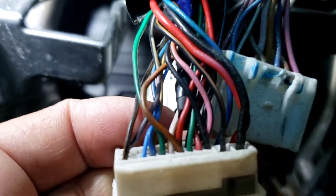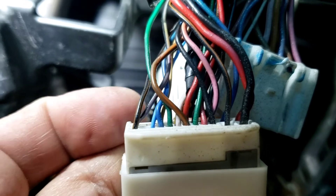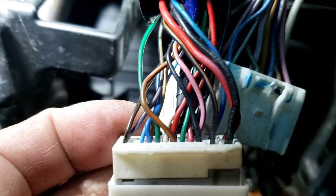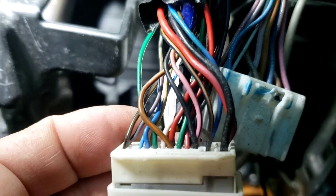I'm not sure exactly which pin number it is — I didn't have time to look up all the pins — but it's between green and white, where the negative of the RCA jack connects for the video input.